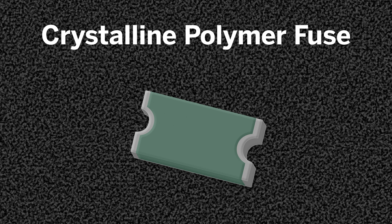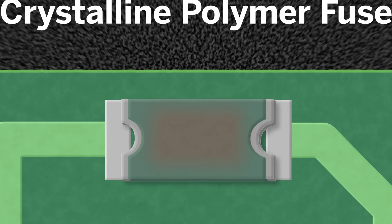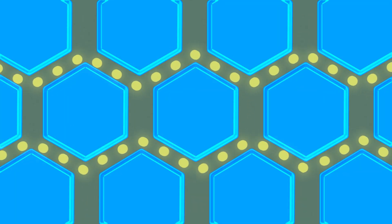In the case of Christina's car, we had an intermittent issue — it came in, it didn't work. Lemmy got in there and started using the load tester and smoked it out several times, broke it several times, and then it worked again. The charge controllers and integrated circuits in a lot of USB controllers have what's called a poly fuse — a crystalline polymer fuse. As these fuses heat up, they essentially trip. If there's more current than they can withstand, they will trip. On the molecular level, the polymer melts, deforms, expands, the conduction of electrons through it breaks down, and the resistance skyrockets — it acts just like an open fuse. The bad side is that from their chemical properties, they can take hours, days, even weeks to reset. That could lead a tech to condemn a port when it's really not a bad port — you just had to wait for it to reset.